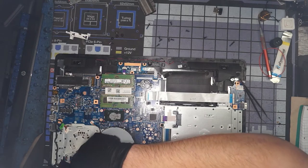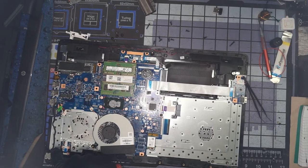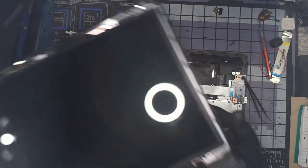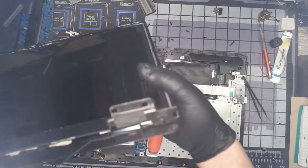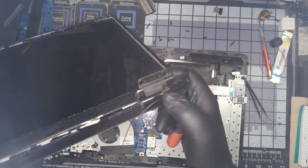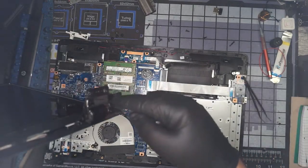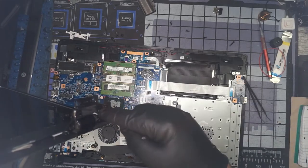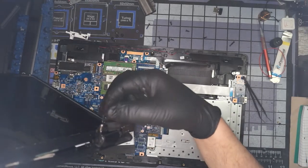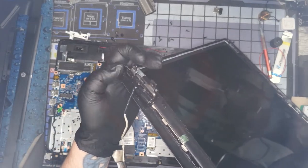I'm going to go ahead and try and reattach the one in this corner here that broke loose. It holds the one part of the hinge. As you can see, it has two parts that ties it down. Other than the main screws, you have two screws per hinge that tie down to the body, and then you have one that comes through the entire bottom case of the laptop into the upper body, and then you have these two flat ones for a little extra support, and that's on both sides. I thought there was only one, but this was hidden under our fin stack, so.